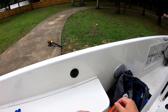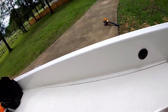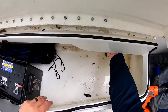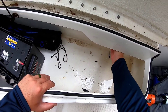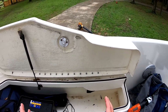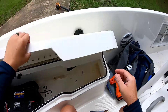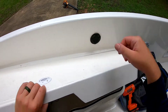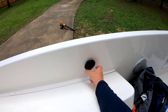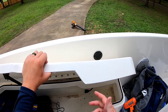That's going to look really professional. We just have to go through the bottom here and grab the other end and pull it through this hole — and I've already got it. There it is! Now we're just going to get our three-bank charger out and mount it somewhere. The plug adapter goes here, and the plug goes down there to your three-bank battery charger. We'll need to get some marine 5200 RTV, go around it, and put some screws in to waterproof everything as much as we can.